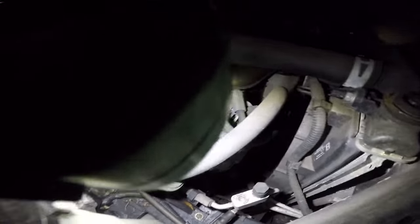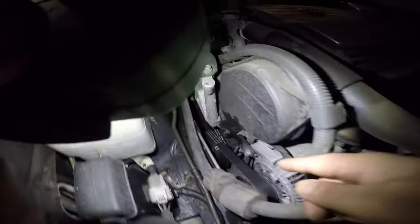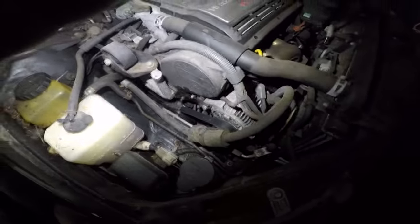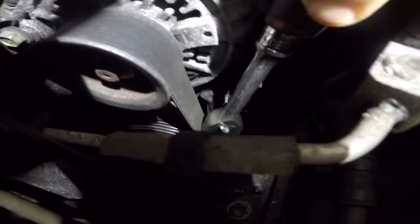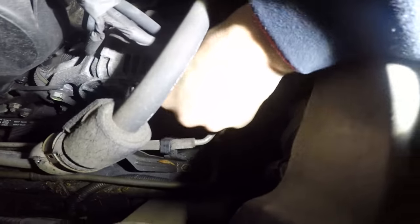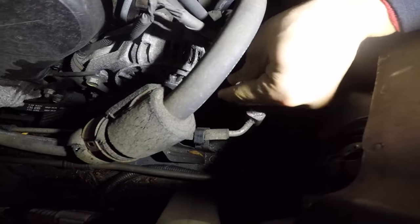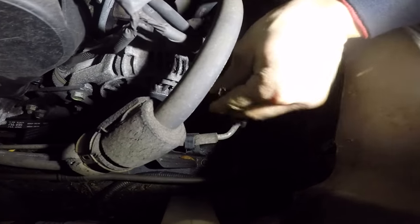So if you have a Toyota Avalon, we're going to loosen up the 12mm down there - this is the adjustment bolt - and we're going to loosen this one up and adjust this belt first. Loosen up that number 12 down there. Get a gear wrench and put it on that bolt. We're going to loosen up this bolt on the alternator and also this one over here, and then the alternator will be able to be adjusted with this bolt here. Just do about two turns - you don't have to completely take out the bolt.